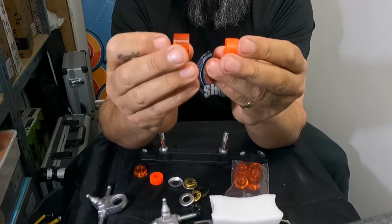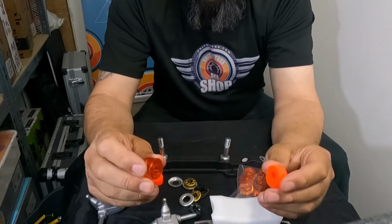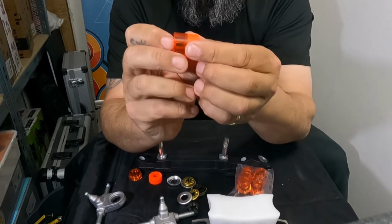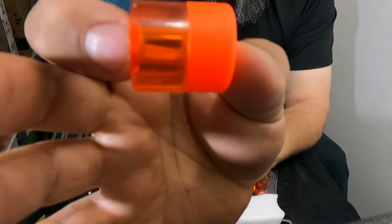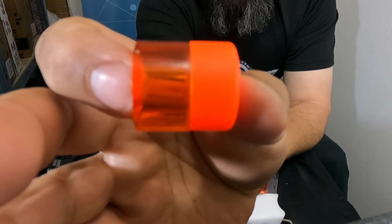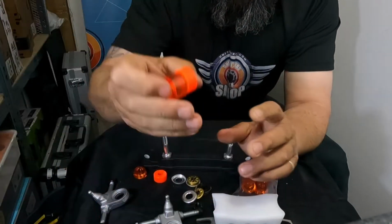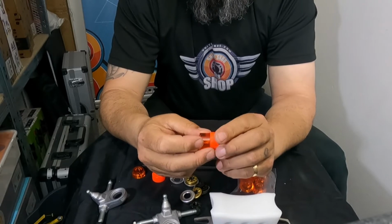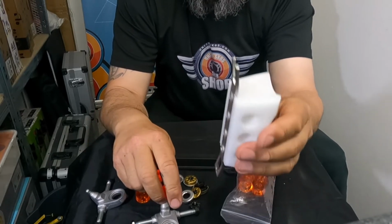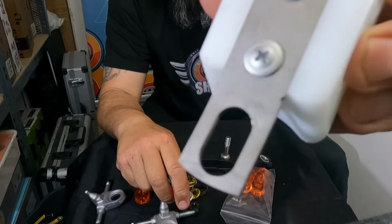Okay, so you see that one, that's your standard that comes with. This is a Powerdyne reactor fuse plate that I'm using for this demonstration. So the standard cushion that comes with that is a lot thicker than the cushion that comes with a disco block. Alright, so that difference is to compensate for this piece of metal. Okay, the thickness of that piece of metal.